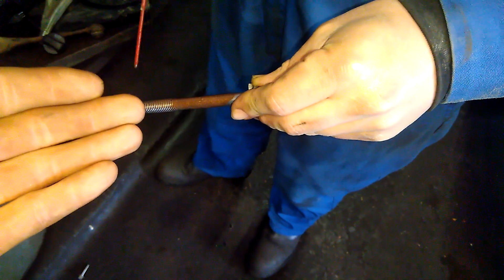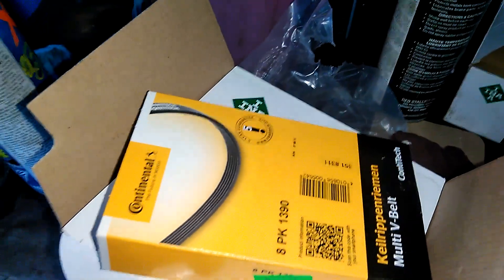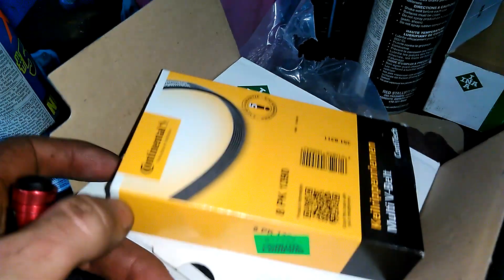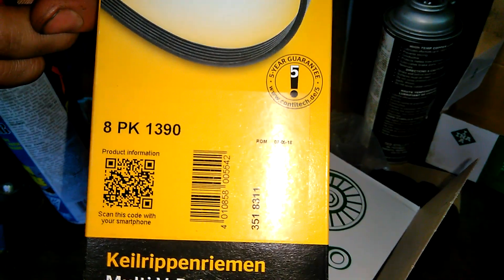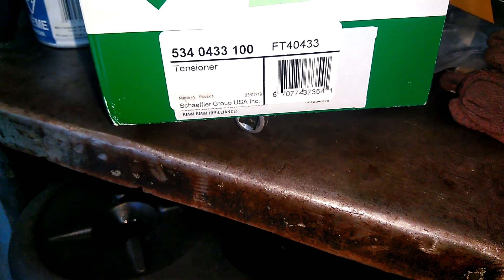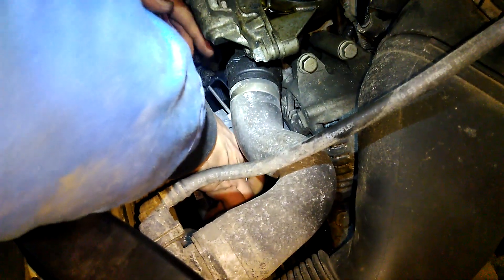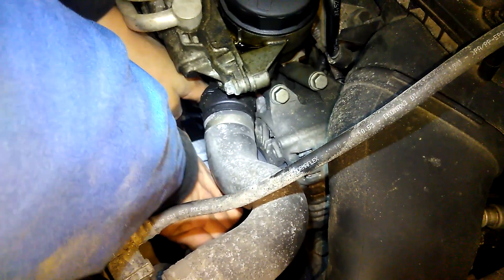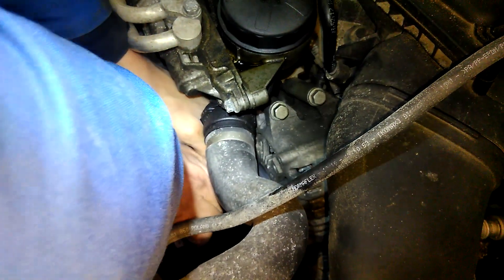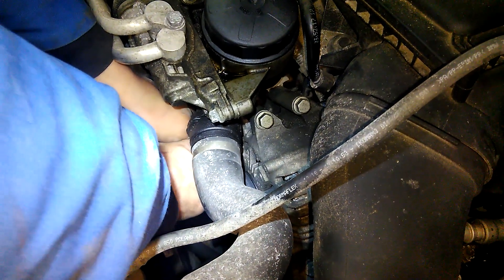If we're using the bolt, sauce it up — copper grease every time. If you are planning on doing this to your own N55 engine, this is the belt and that's the tensioner number. And this is how you pop it back in — you just leave the stick in there and you just keep working at it. People always wish they had bigger hands.